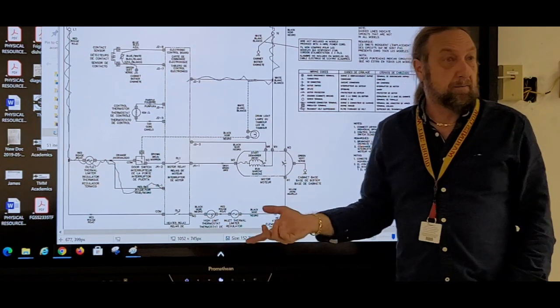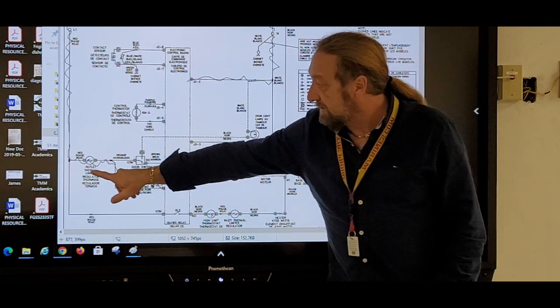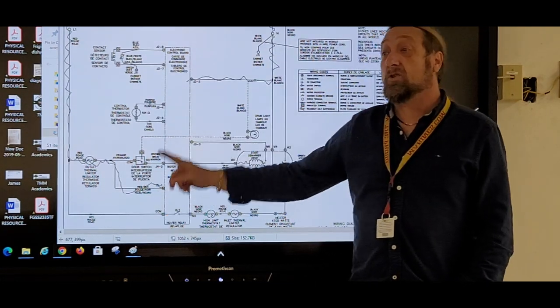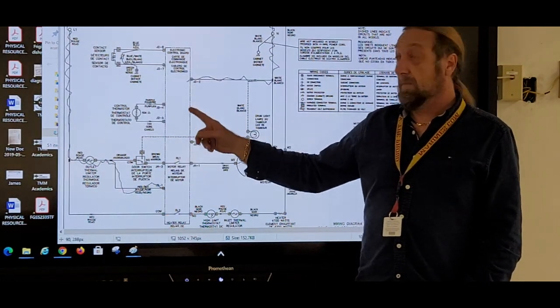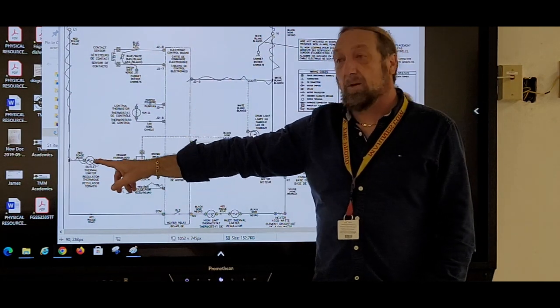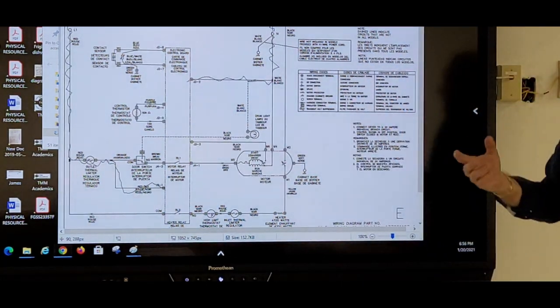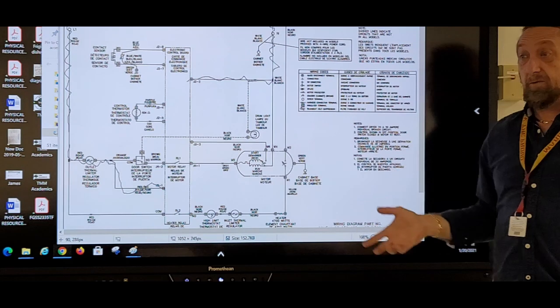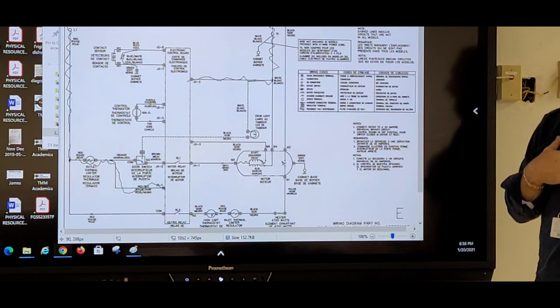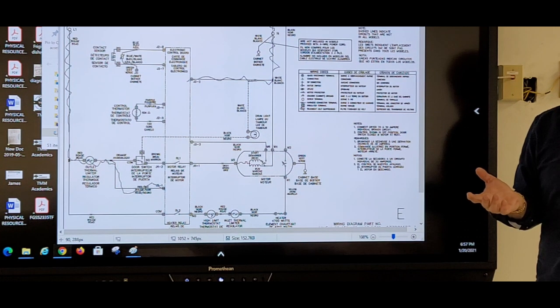What could be bad? Outlet, thermal limiter. This thermal limiter here. I said, I don't have 120 here. I have it here, but I don't have it here. It could be a broken wire. We could always say there's a broken wire, but very rarely does a wire break in the middle of a circuit. I have seen it. So anything before the board, any fuse, any type of control before that board, if you ain't getting 120 at the board, that's what you check.